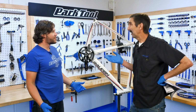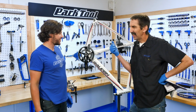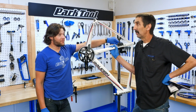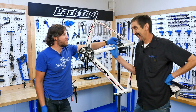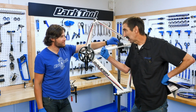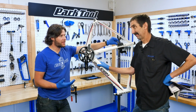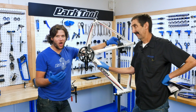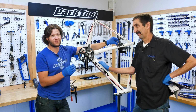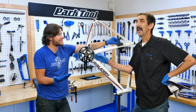Now, clearly, winner, chicken dinner. Take out your seals and take out all the grease and you're gonna be fast, right? For a couple hours, maybe, give or take, depending on conditions. And remember how much stress and load we have here on our little track of steel. None. There's gonna end up being a lot of fretting and galling on those bearings. It's gonna wear out extremely quickly. There's gonna be zero protection from moisture getting in there, or even other contaminants like dust and sand.